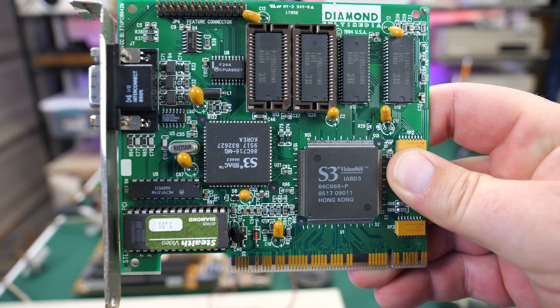There we go — the little display is working. The CD-ROM clicked on and the hard drive is spinning. Still not getting a display at first — the hard drive cable was turned around 180 degrees. After fixing that: I got a POST beep. Plug-and-play cards detected. Award BIOS from 1995 — that makes sense given the age of everything on here. CMOS battery failed — press F1 to continue or Delete to setup.